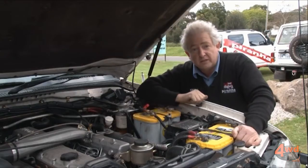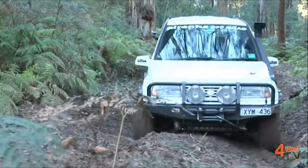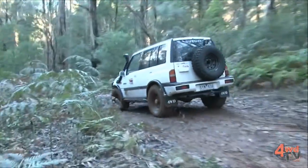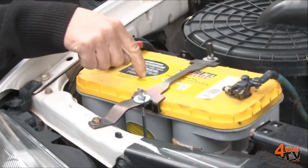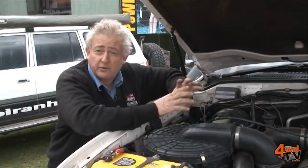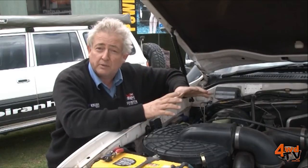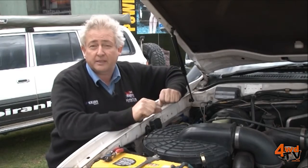We'll just go over and have a look at this fuse box and this isolator now. This is an eight-way fuse box. It allows for one power in from your auxiliary battery, then eight individual separate fuses out, so you can have each circuit individually and appropriately fused. Much safer and much better than just having one enormous fuse, which won't blow until you put massive amperage through it. And it also protects each individual appliance separately.